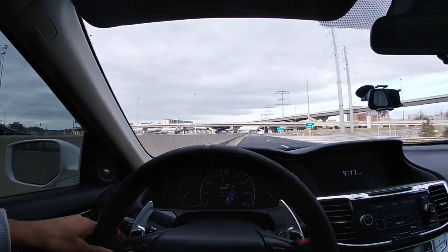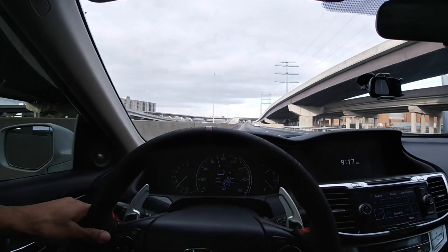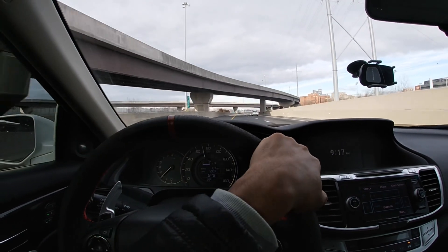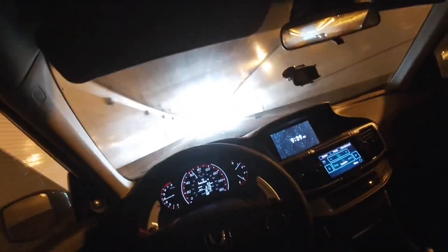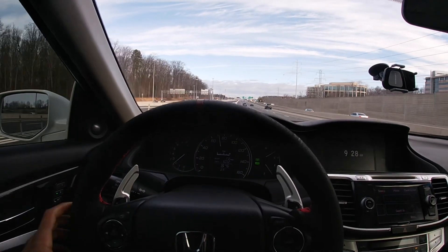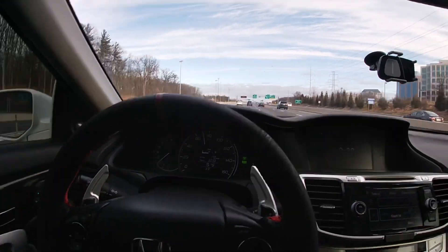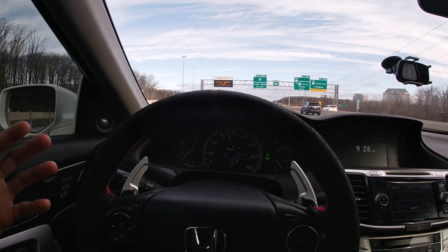It fell off a lot. It took me about a week or two to notice — I felt like I gained low-end torque, but I really felt my top end got worse. Once I got into third and fourth gear or did a pull from above 60 miles per hour it felt weak, weaker than stock honestly. Now I can't really remember what it felt like stock with just the pre-cat deletes, but I know it pulled harder then versus with the manifold spacer. Now that I have the J-pipe I feel like I gained some of that back.